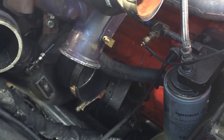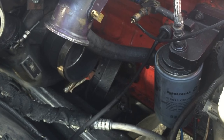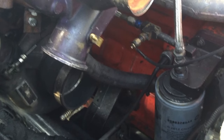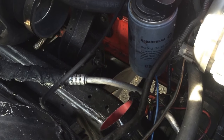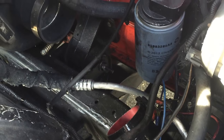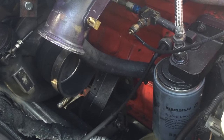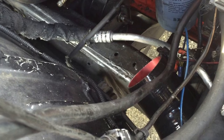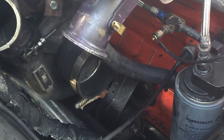If you don't have compound turbos you can still do this - some guys like to run just one single big turbo. I prefer the compounds because you get instant boost. It can still be worked out, you just need to do a little planning. Your setup may work a little differently - you may need a 90-degree boot or whatever - but just figure it out and it'll work out for you.